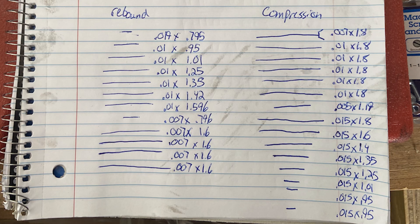Here are the shims on the rear of the vehicle — just a boatload of shims, usually around seven or so. One interesting thing we found is there's a flutter shim on the rebound stack, which as far as we know is not very common. One of our main complaints with the Talon is how much it kicks in the rear, and we think that flutter shim on the rebound might have something to do with it. Going forward, one of the first things we'll do is take out that flutter shim and see how it affects the vehicle.